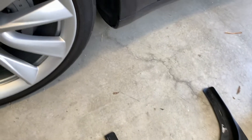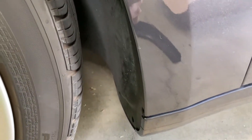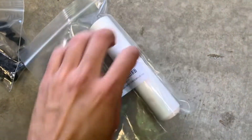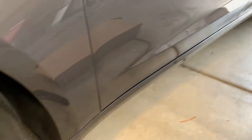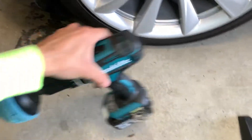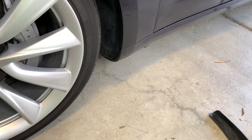What I also noticed — and I read this in reviews and saw YouTube videos about it — is that if you don't put paint protective film (PPF) like 3M underneath, you get a little bit of dust that settles and rubs, making an outline where the mud flap sits. So I went ahead and ordered some 3M cut from Vivid on Amazon, and I'll be laying that underneath the mud flaps. I also have this ice speed compound for scratches and swirls, my Makita drill, and a Mother's buffing ball — super cheap — to try to get rid of those swirls before I lay the new PPF.